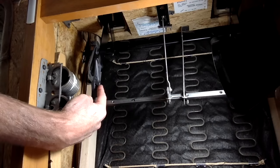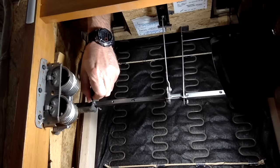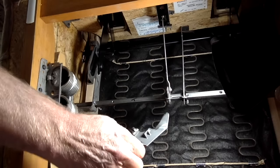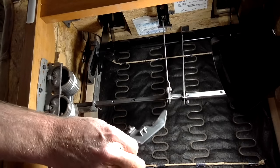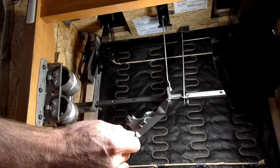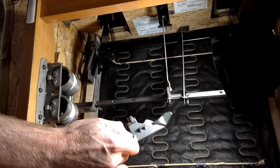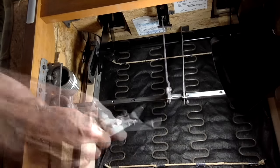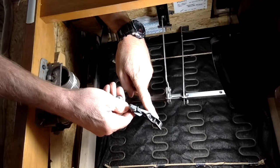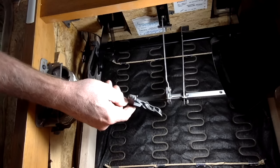Here is the clip on this side. I'm going to go ahead and remove it. There's a little tab here — I'm going to lift that off. That releases it and now it comes off. Now these are plastic parts. I'm not a big fan of plastic parts on metal mechanisms, but in this case these are really convenient and easy to replace for most people, and they seem to be pretty durable, so it's not a bad trade-off. When these wear a little too much, the steps will become gouged or worn, and that means that this lock needs to be replaced.